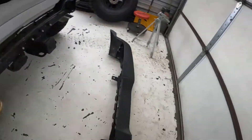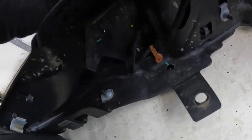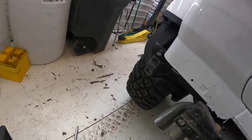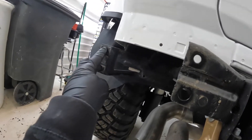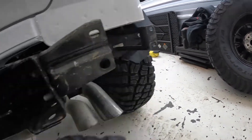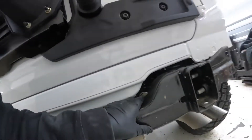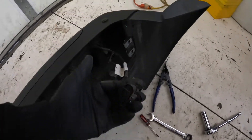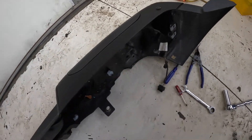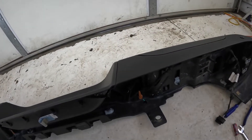To do this I decided to take the bumper off to get better access to where the reflectors are right back in here. To do that there are two bolts on this bracket here, two bolts on the frame here, same on the other side, and then two bolts in the very bottom, and then you have an electrical connector. I just pulled the Christmas tree clips out, pulled that connector apart, and the bumper is off. Now I've got good access to be able to pull those reflectors out.